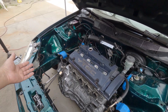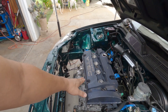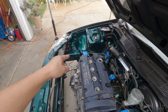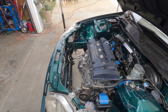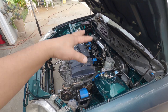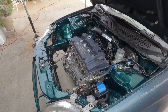But from the looks of it now, I'm pretty much satisfied. As you saw earlier, I was checking the clearances on the valve cover — I added two shims, or it will be three shims or washers. I'm all good there; I'm satisfied with the height. And as soon as I get done with the rear T-bracket, we'll move to the next step, which is finding out if my idea will work using the H22 half shafts.